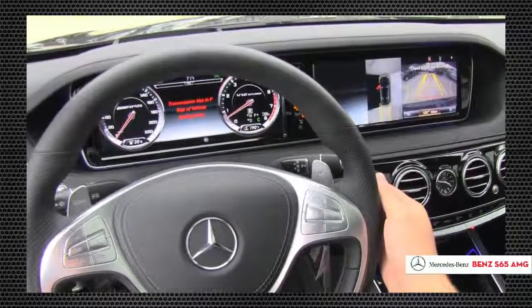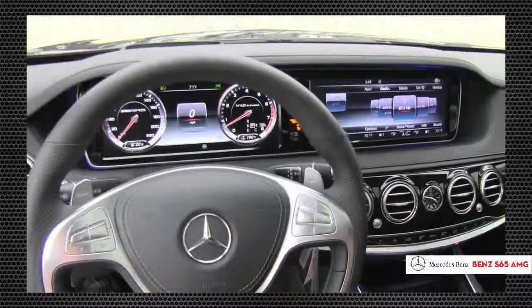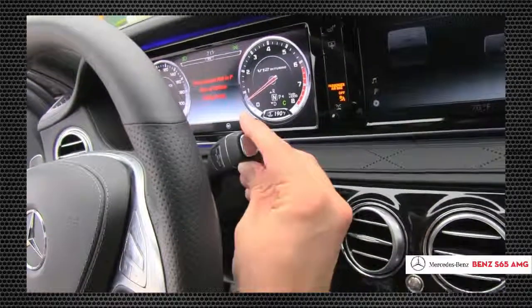Controlled through the direct shift selector on the steering column, you simply hit the brake, pull down to drive, half a click up is neutral, and all the way up is reverse. Park is activated via the chrome button on the tip of the lever.